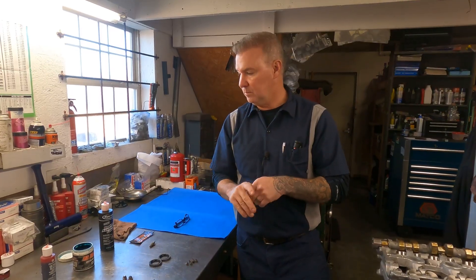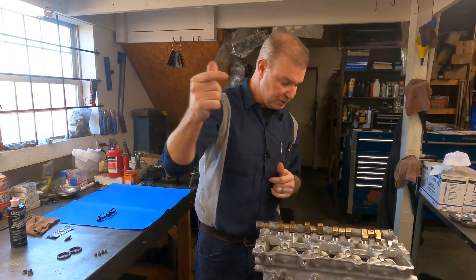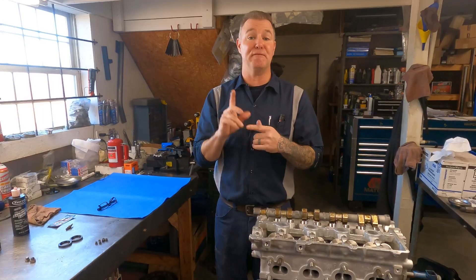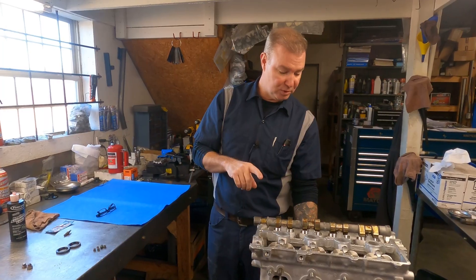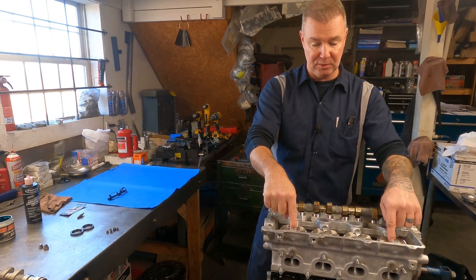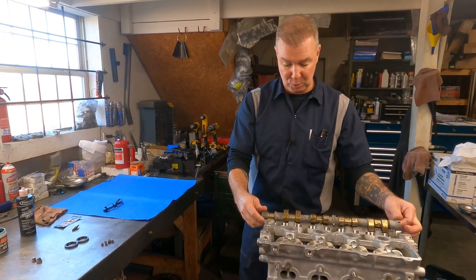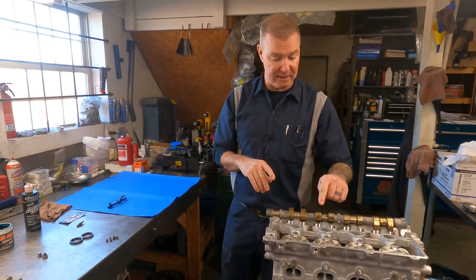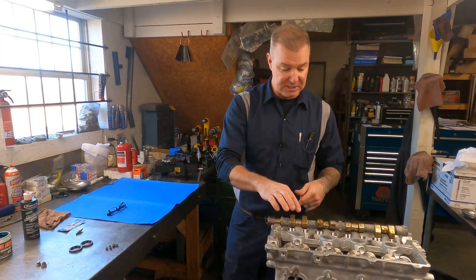The other reason I use the thicker stuff on the camshaft: think about when you're first priming your engine. The oil is going to come into the block, go down the main galley, and straight into your mains first, then into your rods. Part of the galley will come up through the cylinder head and go through all the galleys before it comes up into the oil feeders and feeds the lifters. So this camshaft is going to turn quite a bit before it has forced oil actually feeding it — and the cam lobes are running directly on the lifter.